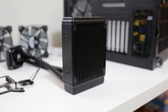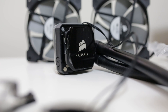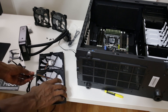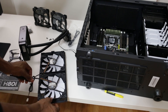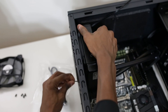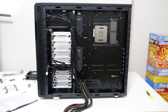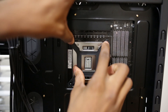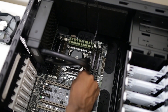Here's a closer look at the H80i radiator, which is going in the back of the case. Here's the pump, which sits right on the CPU and lights up different colors when on. For installation, there was already a Fractal 140mm fan in the back of the case, so I removed it and added it to the dual radiator panel in the front — now we have two large fans in the front. The fan for the H80i goes in the back, directing airflow straight front to back. Flipping the case around you'll see the large cutout behind the motherboard tray where you mount the LGA2011 bracket, and then attach the CPU cooler from inside the case. H80i — mission accomplished.